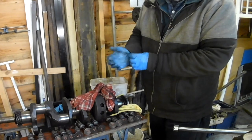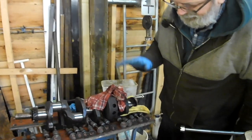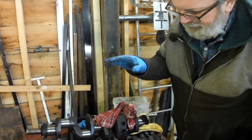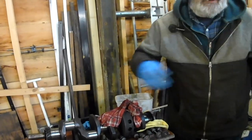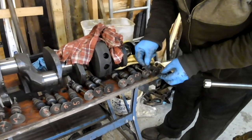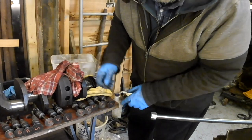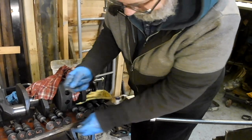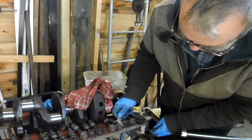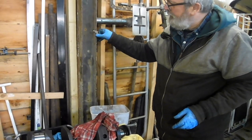Now, I can't remember if I put the dots on the exhaust or the inlets, but the inlets might be magnetic and the exhausts won't be magnetic. So I'm going to go and get a magnet and test. Right. That's magnetic. Right. See? Magnetic, look. Not magnetic. Magnetic. So no dot is inlet, proven by that one and that one. But what this means is that I've got an exhaust valve on the inlet on number 2. Okay. That's a magnet out of a computer drive.